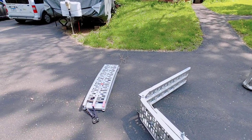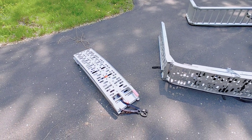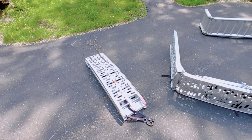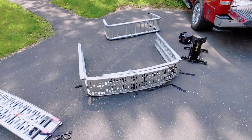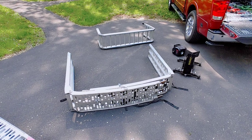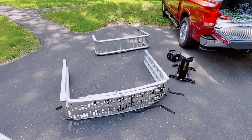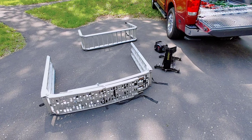Let's talk about loading the bikes into the truck. I use these aluminum ramps — they're $130 to $150 a pair. I set up one ramp to walk on and one ramp for the bike to drive on. I start the bike, put it in gear, use the clutch and the gas, and feather it up rather than pushing it. It just makes sense to use the power. I'm a short, old guy — pushing a 500-pound bike up a ramp is just not a good thing to do. A little technique goes a long way; if you just use the clutch and the gas, you can get into a truck pretty easily, especially if you practice it.